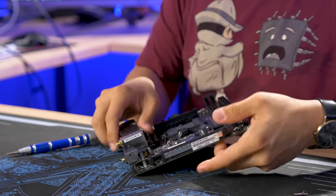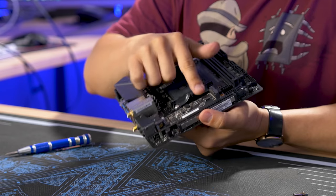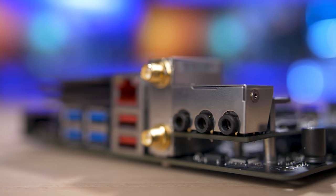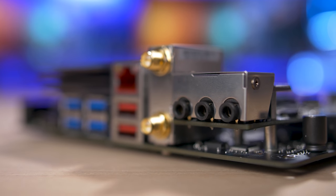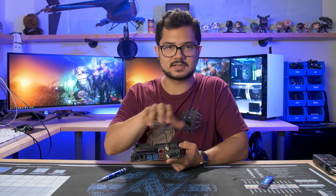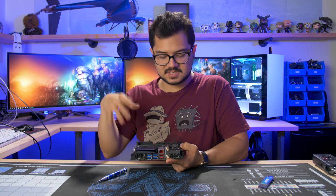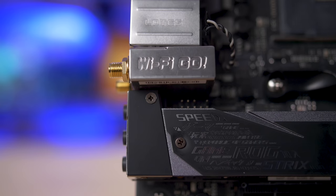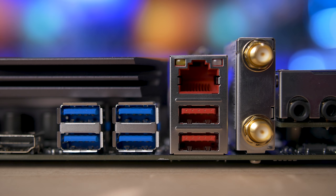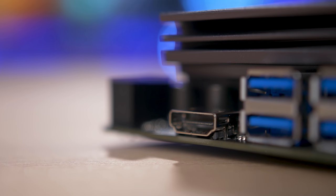This board has also got audio built into that area — not only is it an M.2 board, but there's audio at the back as well, and it's got LED enhancement that shines red, blue, and green to let you know what the inputs are. You've got 802.11ac Wi-Fi alongside an Intel Gigabit NIC, two USB 3.1 Gen 2 ports Type A, as well as four USB 3.1 Gen 1 ports also Type A. And finally, there's an HDMI out with HDR support.